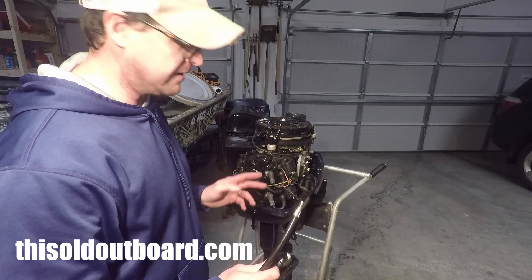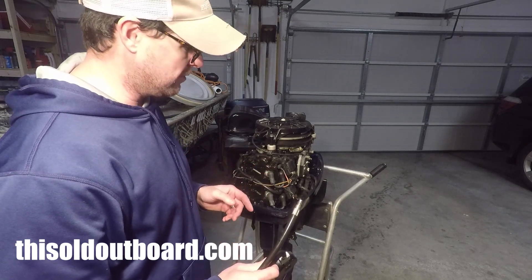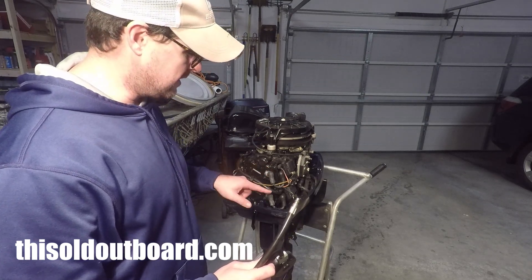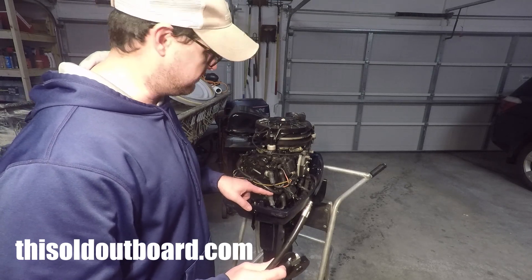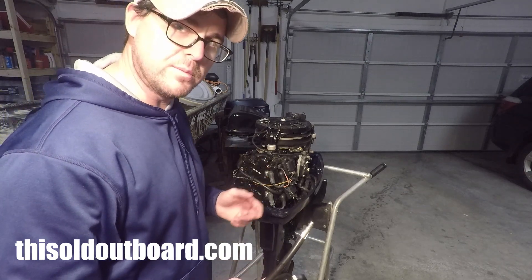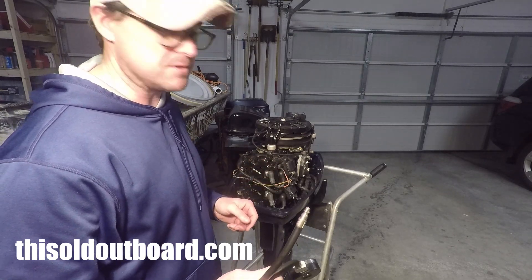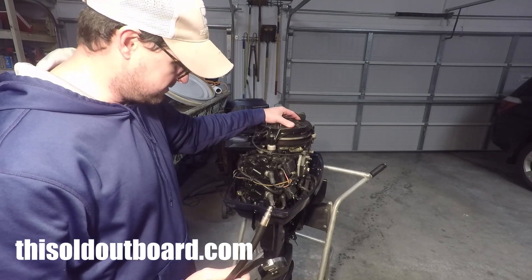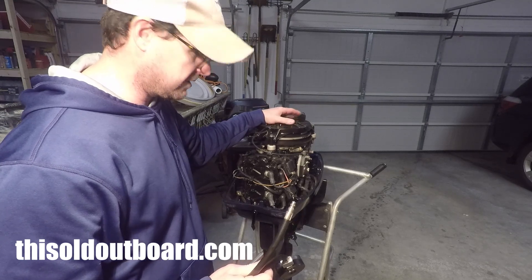I hope the readings are really close relative to each other. You don't want to buy a motor that has more than a 5 or 10 PSI difference between cylinders. For instance, if you have 100 PSI in the top cylinder and 80 PSI in the bottom, that's not good — that's a 20 PSI difference. If it cranks cold in a couple of pulls, I wouldn't worry too much depending on what you want to use it for, but we're going to test this one out to inform our judgment.